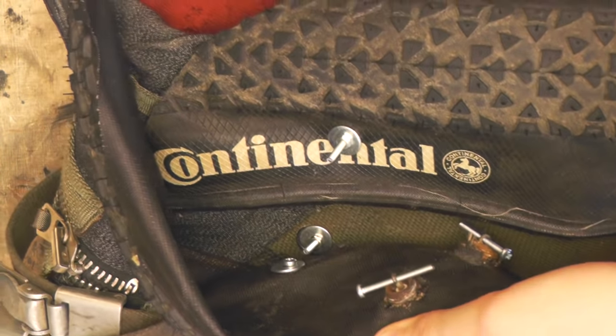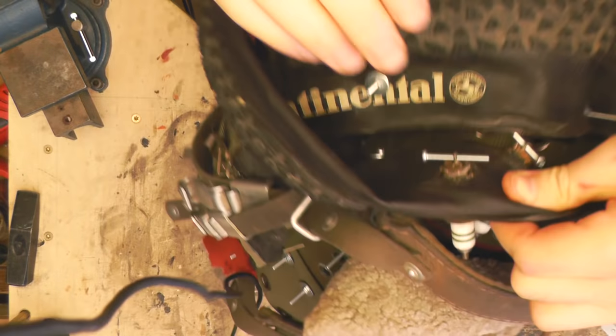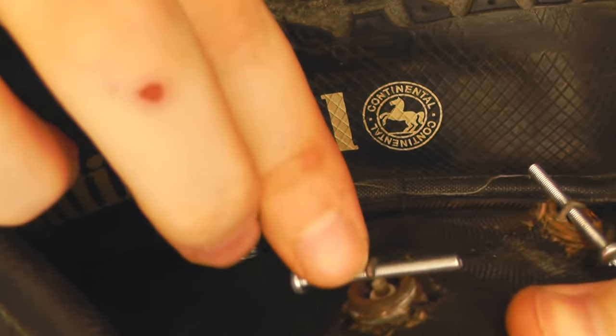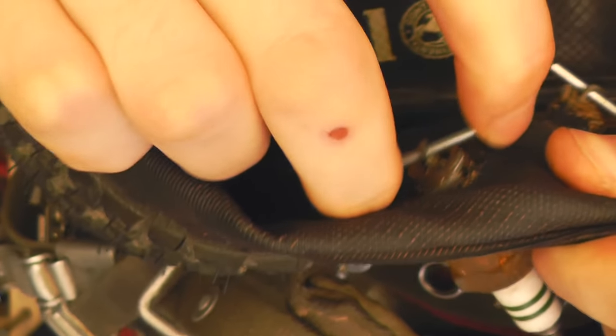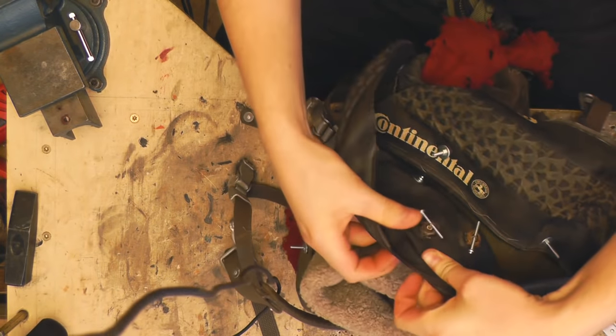All right, and that's really enough. So there it is. It's not going left or right because of the thread of this bolt — it's acting as a stopper. And it's not falling out in any direction. So in case someone yanks on this spark plug, or it gets hot somewhere or whatever, this will act as a security.